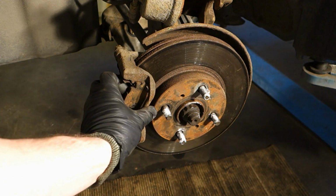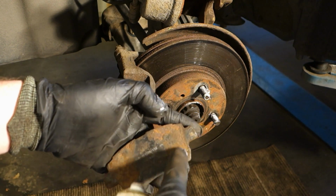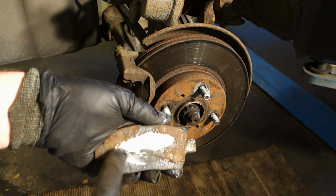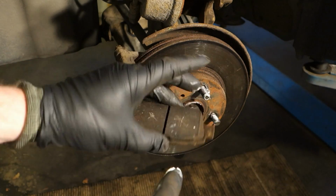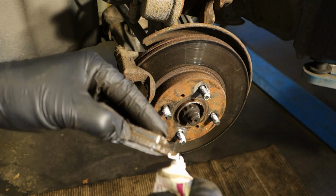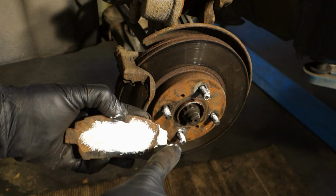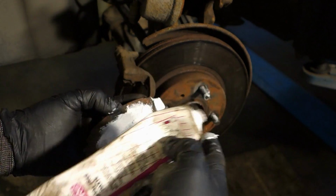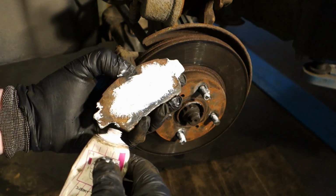And first one, when we take our brake pads, normal area is always that area in here, and in that area I can insert my grease in all areas. In that outer area, remember, only outer, not in this inner area. And then these upper holes in that area I can insert this specific grease, and there is also some other grease which is suitable, but at that point I can install this grease.